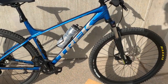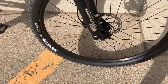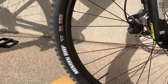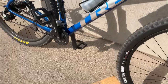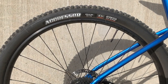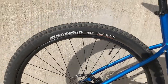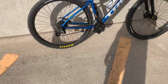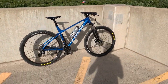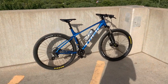For the upgrades: it actually comes with Bontrager tires, but I just got through installing these Maxxis Minion DHFs on the front in the EXO casing. And I've got the Aggressor by Maxxis, EXO casing, in the back. The reason I chose the Aggressor and not the DHR is pretty much the geography of the region I'm in — Austin, Texas. A lot of the landscape here is very dusty, hard rock. A lot of the city is actually built on a bed of limestone.